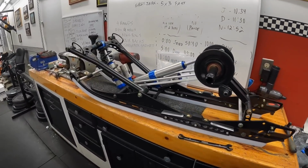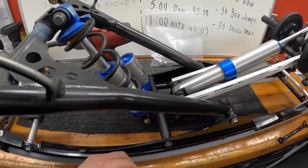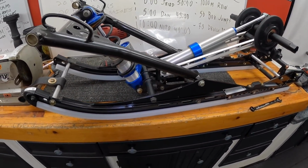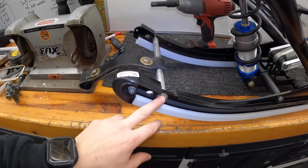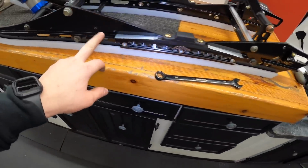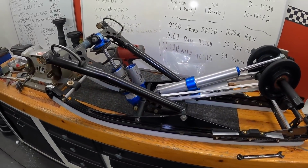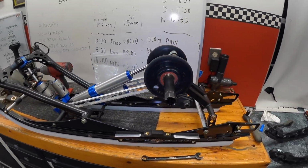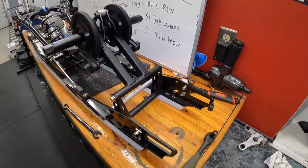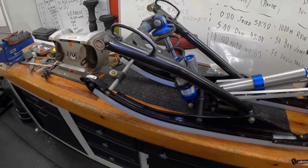All right. So we got all of the big, important bolts. Let's turn our light back on. So we got this one done, that one, that one, that one, that one. So this whole center section is now in there. Loctited, again, I used blue because I don't want it to be in there forever, but I also want it to not fall out.